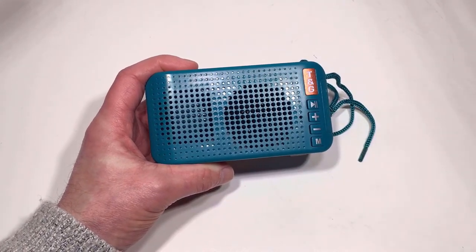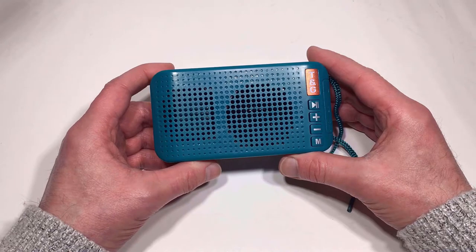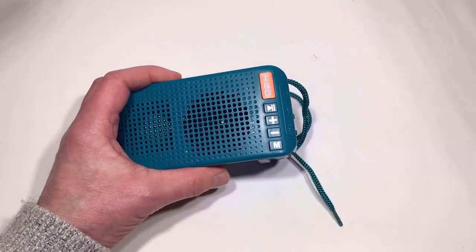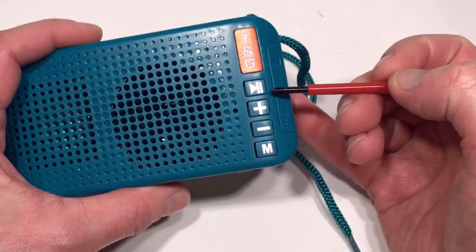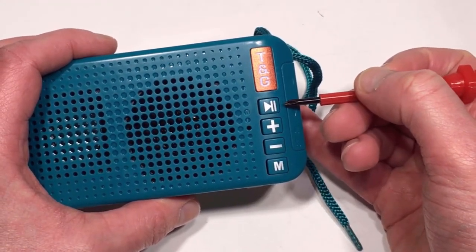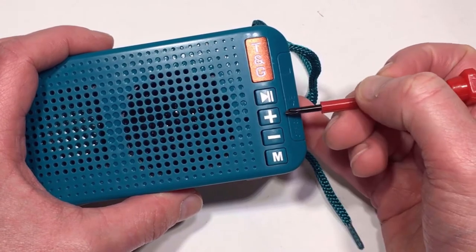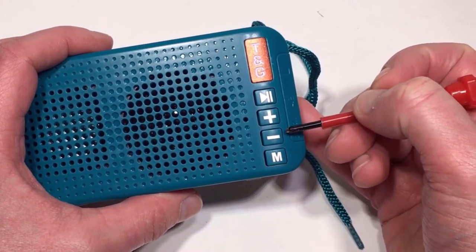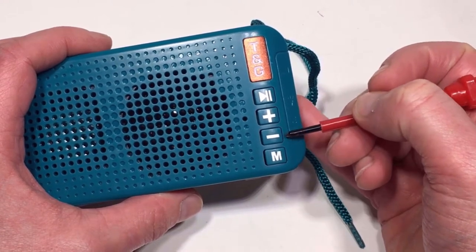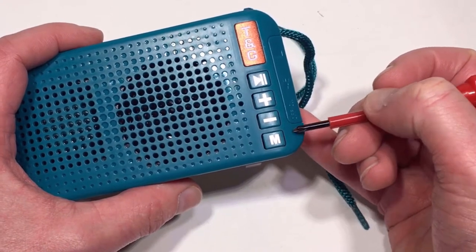The 52mm driver is rated at 5 watts according to the data sheet, though to be honest it's not going to deliver a full 5 watts — nevertheless it gives a very good account of itself. Moving on to the controls on the right-hand side: we've got the play and pause button, used primarily in MP3 mode for going through tracks but also for scanning FM stations. The plus and minus buttons adjust volume up and down, and also let you move up or down a track in MP3 mode or up and down a station in FM mode.